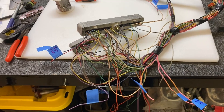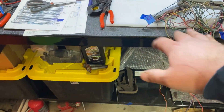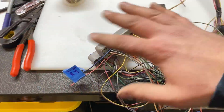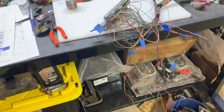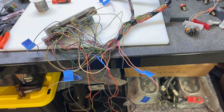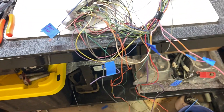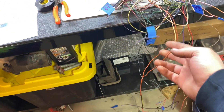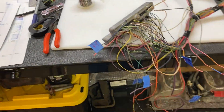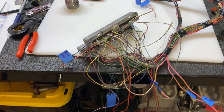So far it's going well — I did misplace one pin that I know of. I'm going to go through and verify wire color on all the pins since most of the wiring colors are consistent. Once I get the PCM I can bring my laptop and wire up an OBD2 port. I'll probably use one of the battery power leads off the PCM for the OBD2 port and use the lt1swap.com style fuse block — same one I used on the K5 harness since it's simple and covered.